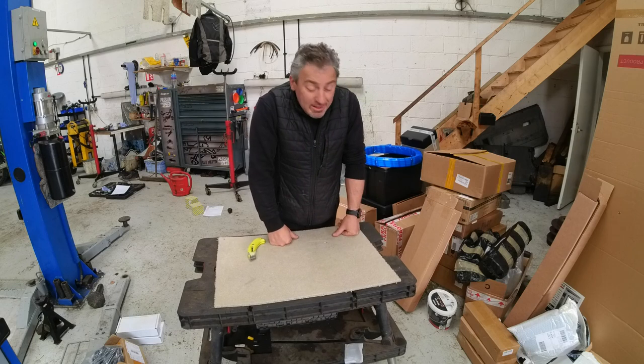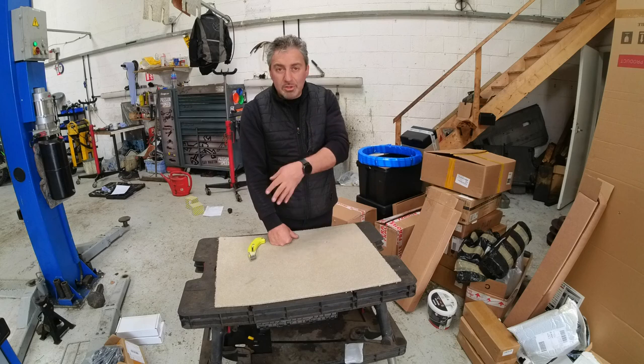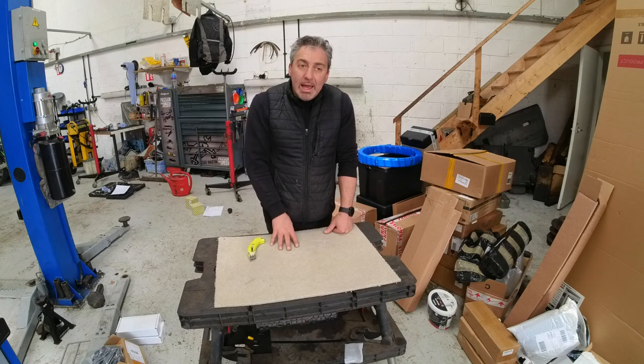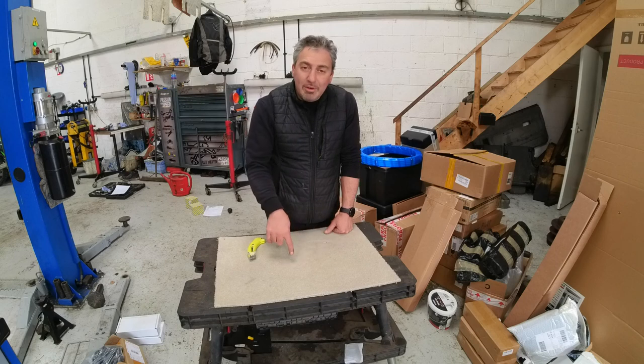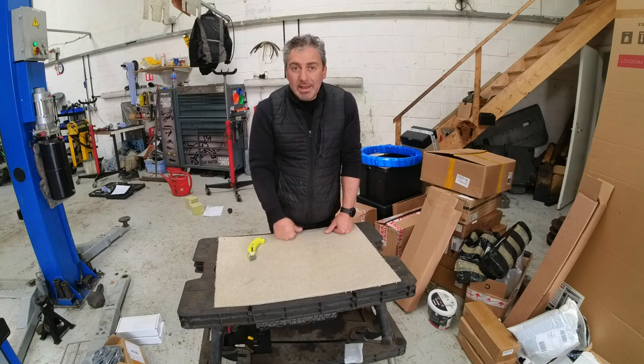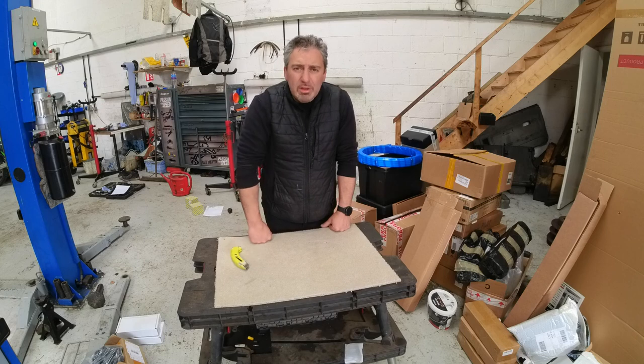I hope you've enjoyed that - there's a lot of stuff we need, and there's more still to get. For the electrical system I'm using the Victron system - it will be an inverter charger. It will take 230 volts from the grid, power the van up and charge the batteries. The solar system will also go into it and charge the batteries and run the system. It will be both a 230-volt and 12-volt system, everything goes through it. It's a smart system - you can Bluetooth it to your phone and it will have a display. It's about £3,000 worth of bits plus cabling - once I get it we'll go through the process of fitting it to the van.